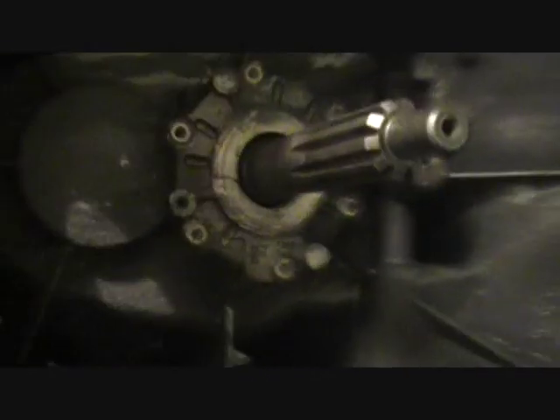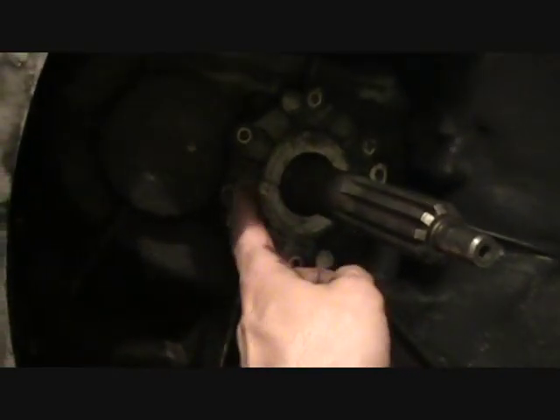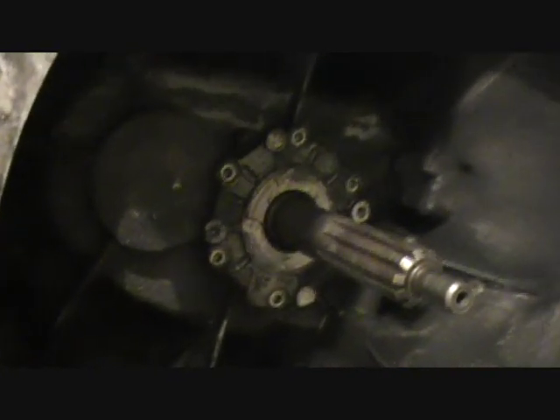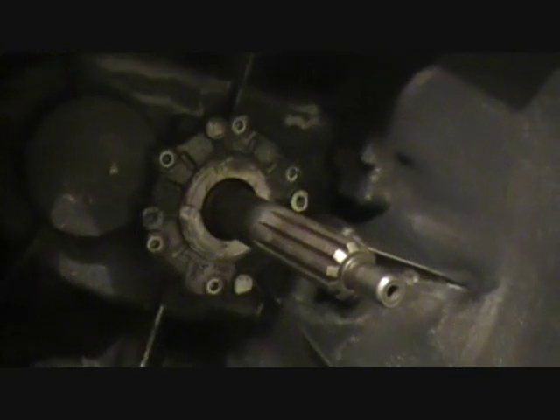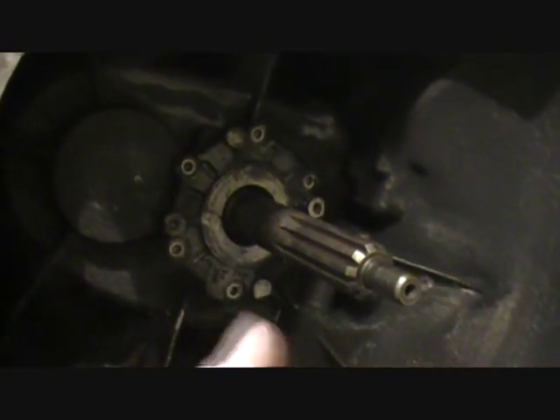Keep in mind that we took all six little bolts off that are inside the bell housing. We took the slave cylinder off — that just comes off. There are one and two bolts that attach the slave cylinder to the transmission. Take those off, then disconnect the hydraulic clutch line — the slave cylinder line.